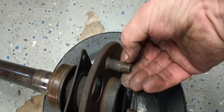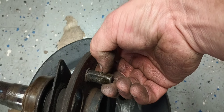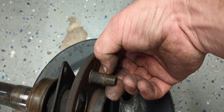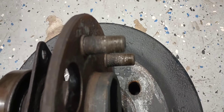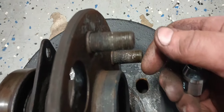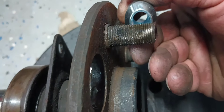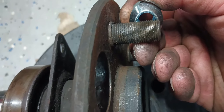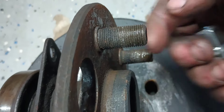As you can see right here, by the wear on this stud, we've had about half the stud as thread engagement. Ideally, guys, you want at least a diameter of your stud as far as engagement. And as you can see, we were pretty close to that, judging by our witness marks right here.